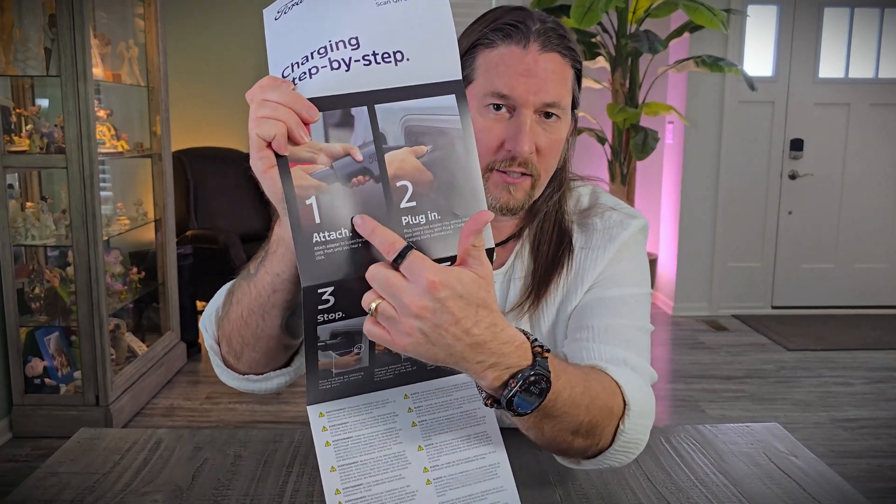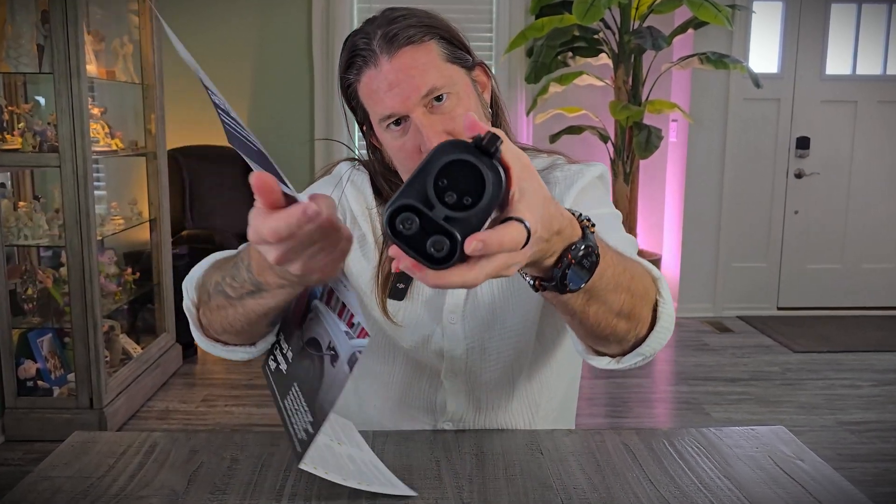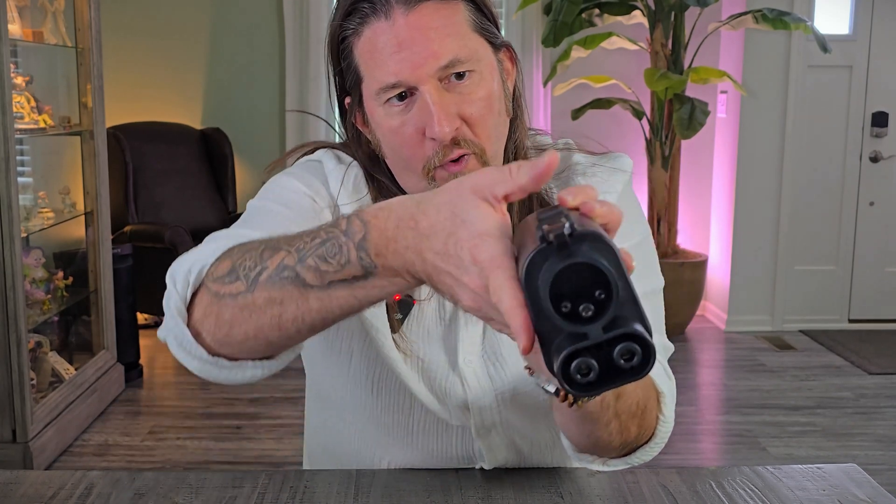Here's how it works, and there's a video on this too. First, you're going to attach the Tesla charger to the adapter. Then you plug that in. When you're all done, you hit the stop button on the EV, then you remove the adapter from the charging port using this button here — just like you would the top button. Once that's removed, then you remove the Tesla charger, which is at the bottom. So: Tesla goes in here and clicks, this goes into your Ford Mach-E and clicks. When done charging, hit the stop button to end the session, remove the top from the vehicle, and once detached, detach the Tesla charger.